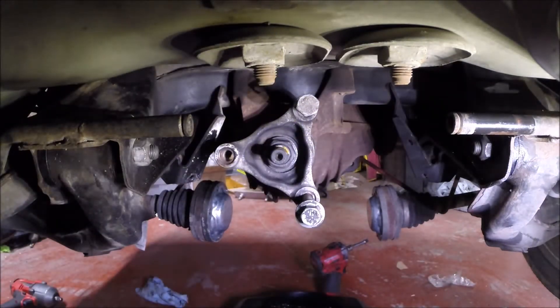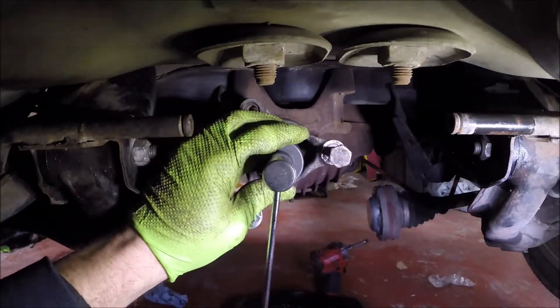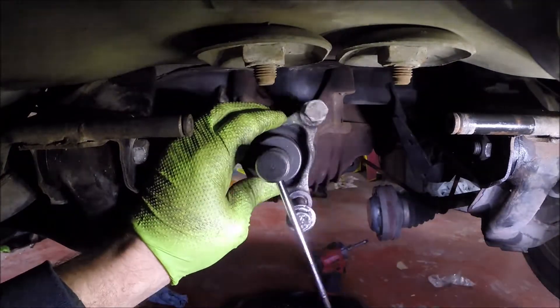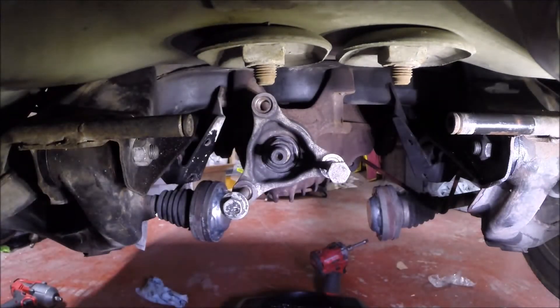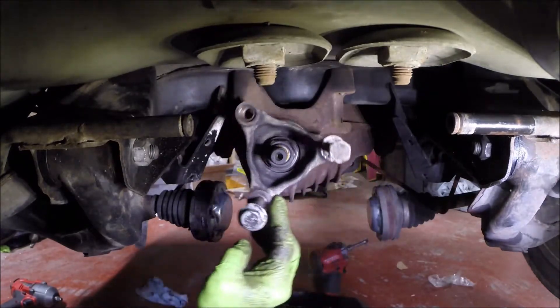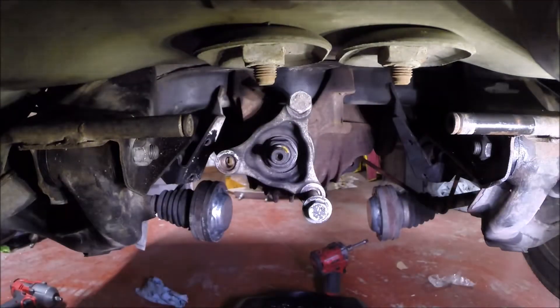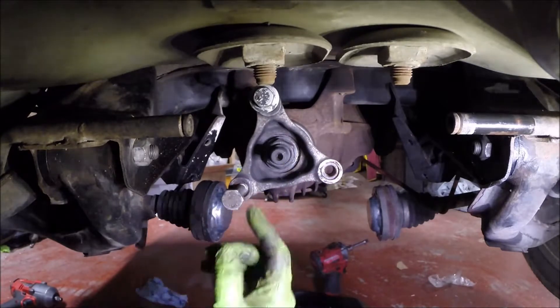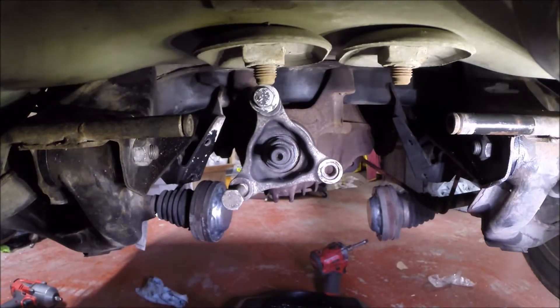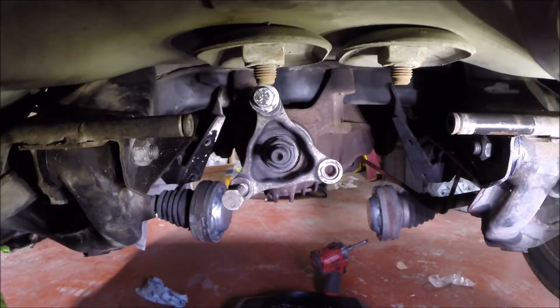It's really hard to tell — I don't even know if I'm doing this right. It looks like it's not even 10, maybe five inch-pounds. I don't really know what to do now. I'll take it down another two thousandths — seems like it's harder to turn than that. I guess I'll try taking it down by another two thousandths. What choice do I have? Rotational torque trumps all.